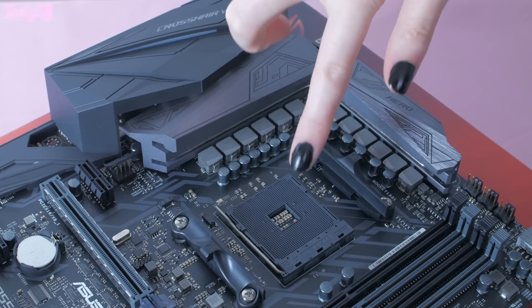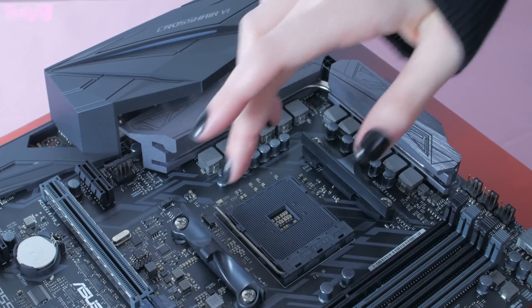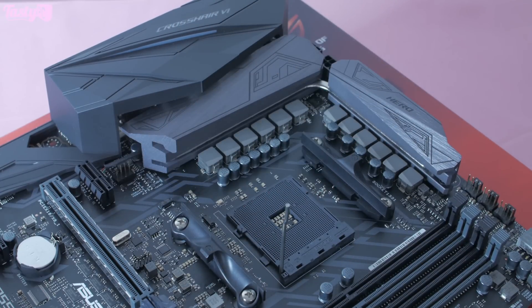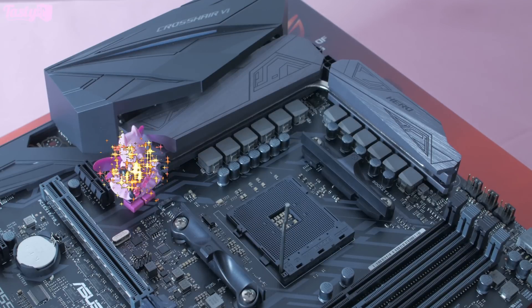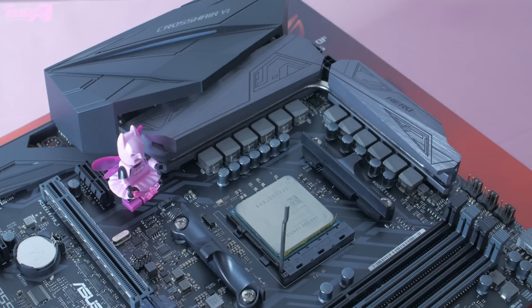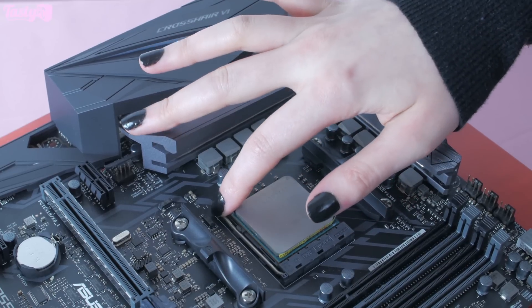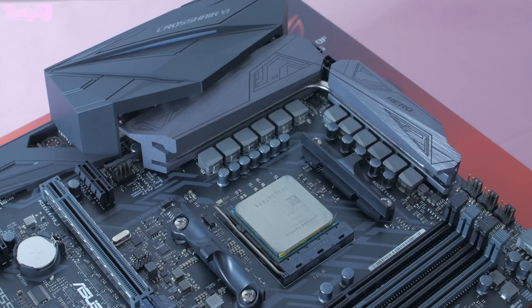This motherboard features AMD's new AM4 socket, which supports all the new Ryzen CPUs. Technically the socket also supports other upcoming CPU ranges like the 7th generation APUs, but I really can't personally see someone wanting to spend more money on the motherboard than on the CPU. With that being said, I think the Crosshair's £250 price tag makes it clearly targeted for high-end Ryzen 5 and Ryzen 7 CPUs. The board doesn't even have any video outputs, telling me that while APUs might be compatible, it wasn't made with them in mind.